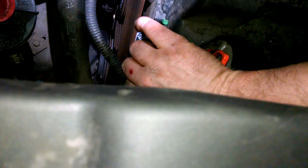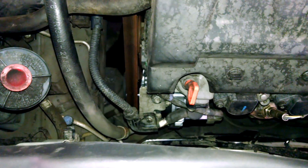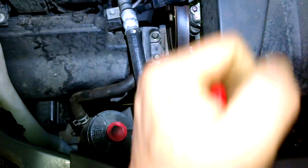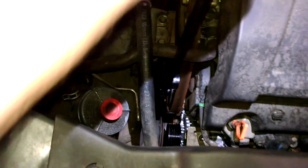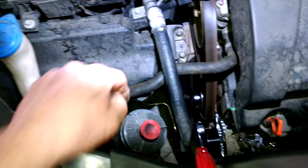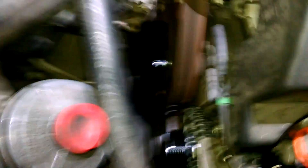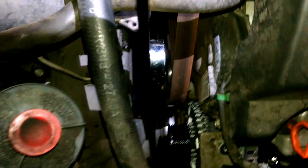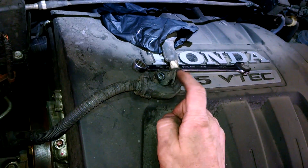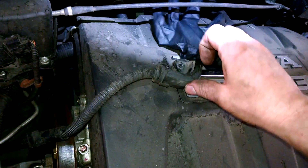There are two 10mm bolts putting it back in. Here I've got the special tool for the tensioner hooked up with a 14mm socket assembly down there — just pry it this way. Leave the power steering reservoir disconnected so you have some flexibility with that hose, and you can pry and take the belt off or put it on as needed. Two 10mm bolts hold the wiring: one for the plug-in on the back of the alternator and one 10mm bolt for the battery positive, which I have covered up just to be safe.